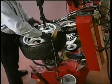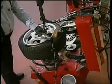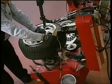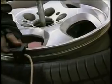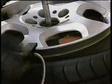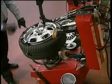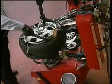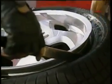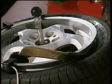You're familiar with 5 or 6 guys fighting a machine with pry bars. This is all done with one person very easily by inserting these blocks. Now the tire is in the drop center, 180 out from the mount head. I can now insert my tool and then remove the roller. That way I don't have to fight the low profile tire.